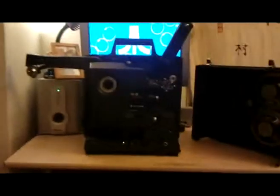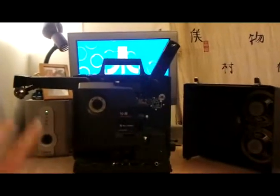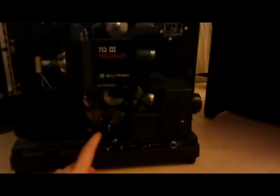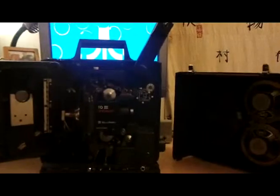The film comes off here and joins onto the take-up reel. On the eight millimeter projector there's an automatic take-up — you just poke the film through and it sorts itself out. With this one you do have to lace it, but there's an interesting little lever here. If you push that, it pushes the film guides on, so you can manually lace it yourself. Or with the guides on, you literally just poke the film in, the sprockets take it up, lace it through automatically, and it comes out the other end.